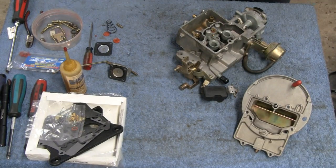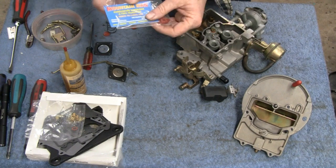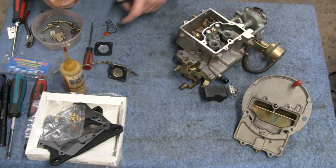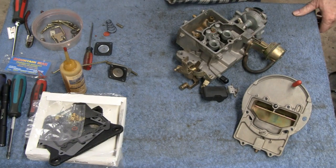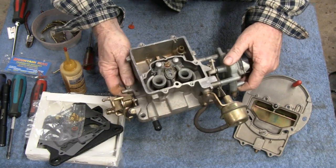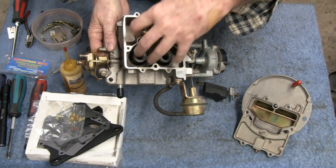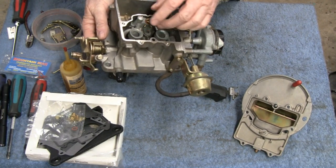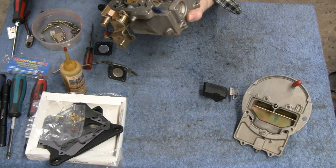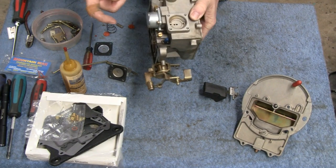It's been about three or four days. I left off saying I was going to order these parts, and they sent three of them in a bag — $4.95 for three, about $1.65 each. I cleaned the carburetor up and it cleaned up real nice. There are a lot of little jets in there and they were all pretty clean. I put the jets back in and adjusted the mixture screws according to the instructions: screw them all in, then back them out one and a half to two turns — I set them at two turns out.